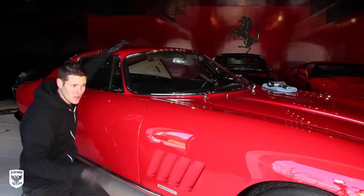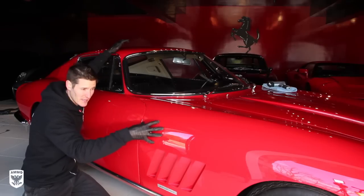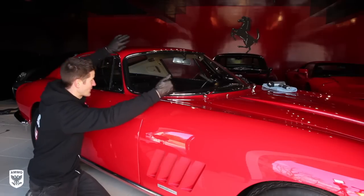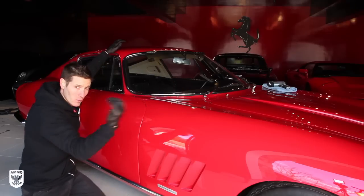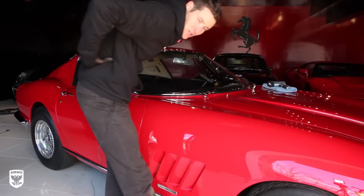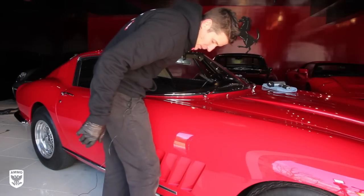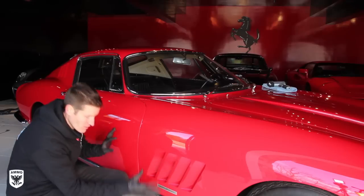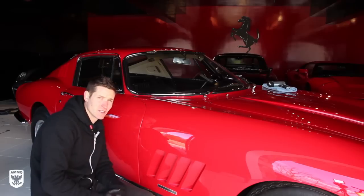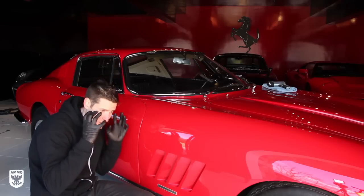On that last little clip of the video, I showed you this quarter panel on the other side, the driver's side. I would never normally start with that. I'm only doing that because it's easy to show on camera. I would normally start from the middle. If I had already done the top, obviously, start from the middle and work my way out. Why? Because if I'm working on the car, sometimes you have a tendency to go like this because your back starts to get sore, and it hurts, especially my back and my knees. Every once in a while you'll bump into this. You want to leave this area down here for the last part in case you've cleaned this already and then you scratch it. It doesn't make any sense. You don't want to keep working over yourself. So top to bottom, in and out, and make sure you think about that next time you're polishing.